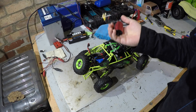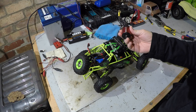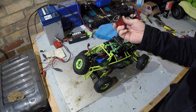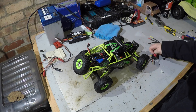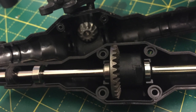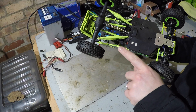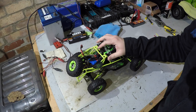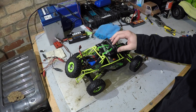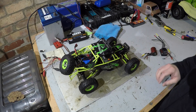Don't need any more than that - definitely don't need more than a 3900KV in there. Anything more is just going to destroy it. I've put brushless motors in loads of stuff over the last five or six years, and this is probably even a bit too much for it. Put anything bigger in and you're just going to start breaking stuff. I've got metal gears in here now, metal diffs all around, upgrade suspension, metal drive shafts, and hopefully it should hold up.